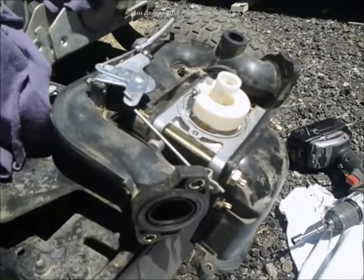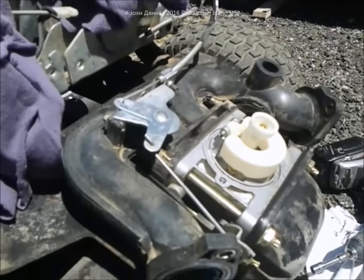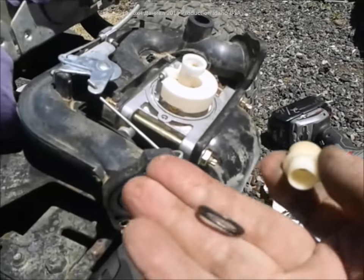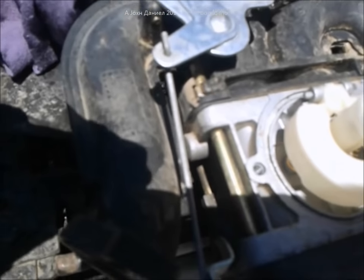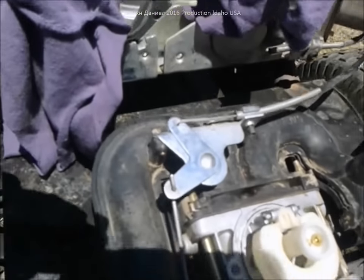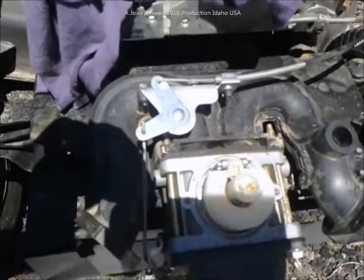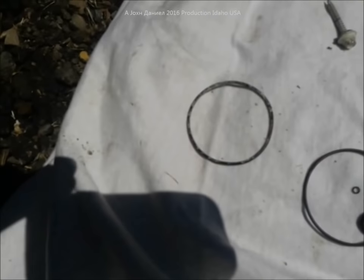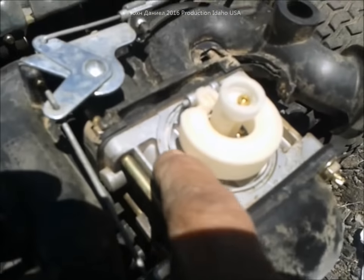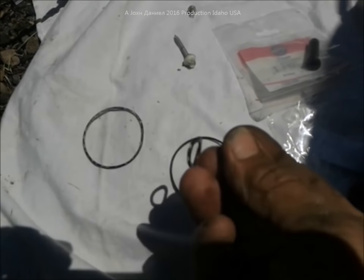I've got the carburetor turned upside down. Here is normally the cause of your ailments in these engines when they start acting up and surging and going crazy — it's this O-ring right here. There are two jets in there, a left and a right. If you look on your carburetor, you will see on the other side an L and an R. The safest way to handle this — because these are two different size stage jets — is to take one at a time. You can order a kit from eBay. It comes with a body ring, the two little O-rings that go to the jets, and the one big O-ring which replaces this one.